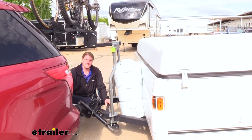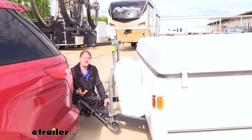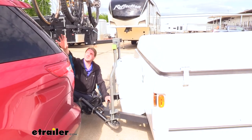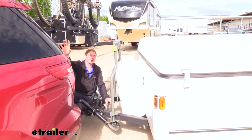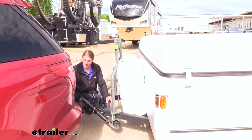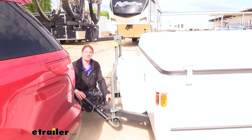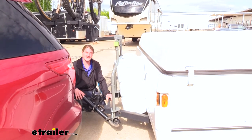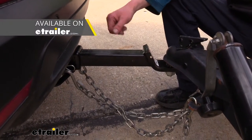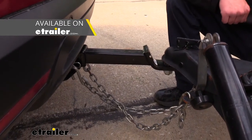On our particular trailer, if we went any further back we'd be hitting other accessories already installed, so we went with an extended ball mount instead. If you're unable to move it back to get the clearance you need, consider an extended ball mount — set up your trailer sharp and close and measure that gap. If you aren't turned that sharp yet and you're already very close, you'll likely need a pretty long extension. We've got plenty of different sizes at eTrailer.com with varying lengths, drops, and rises.